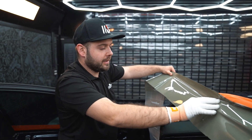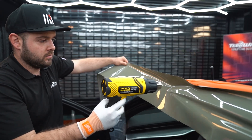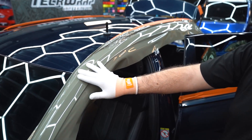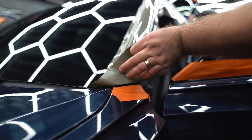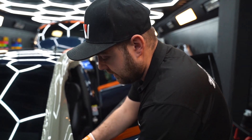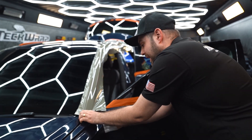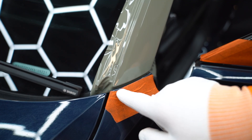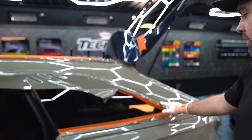I always cut the top pillar straight, then apply some heat on the top corner and twist it a little bit to give it the shape. At the bottom, we need to tuck the vinyl quite deep inside behind the front fender — it's very visible here, so I'll show you how to do it right. I'll cut like a centimeter or so, maybe push it behind, and apply some heat. Now we can carry on doing the cut around the trim and tuck the vinyl under the rubber.